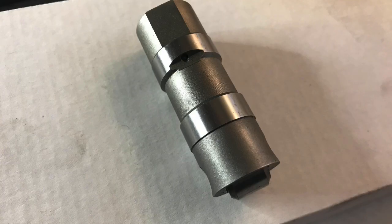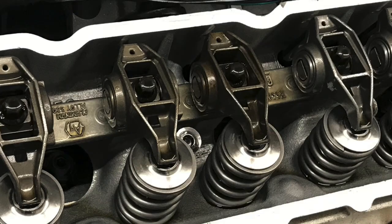The other things that can affect pushrod length are the lifter. Some lifters are different — the distance between the bottom of the roller and the cup where the pushrod sits. If you change that distance, you will need to adjust with different pushrod length. Rocker arms can also affect it. If you install a set of aftermarket roller rockers with guide plates and studs, you may need to adjust the pushrod length. But again, this system works for those too. So what do you say? Let's get started.